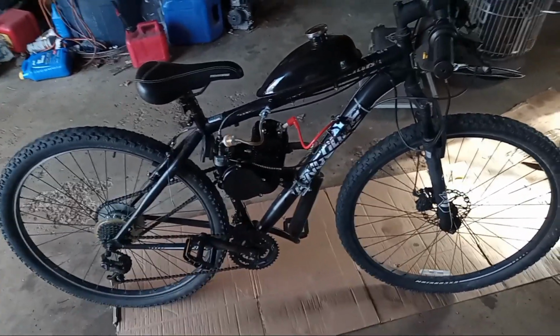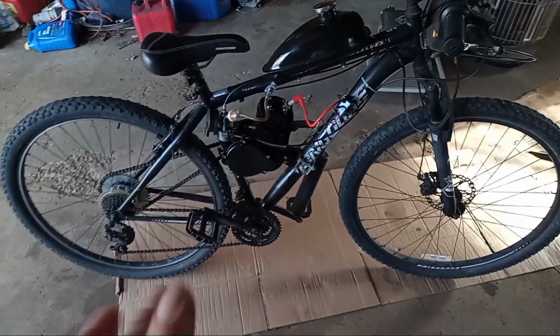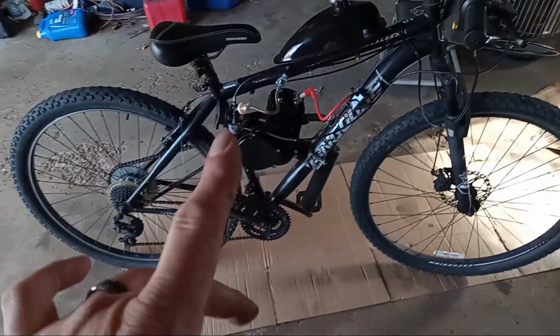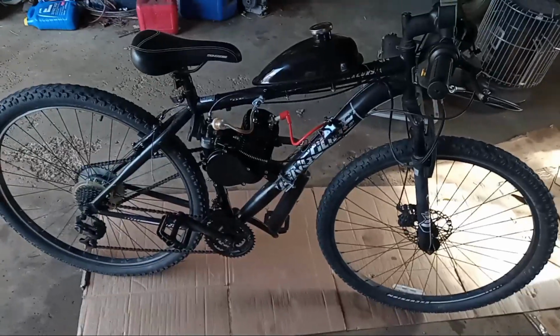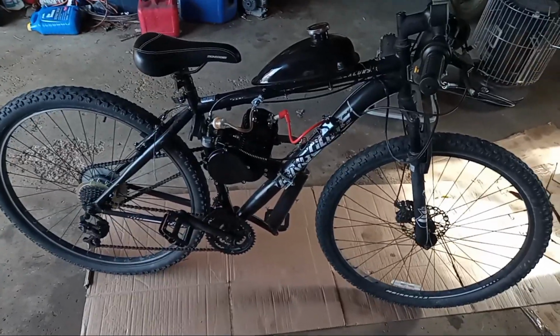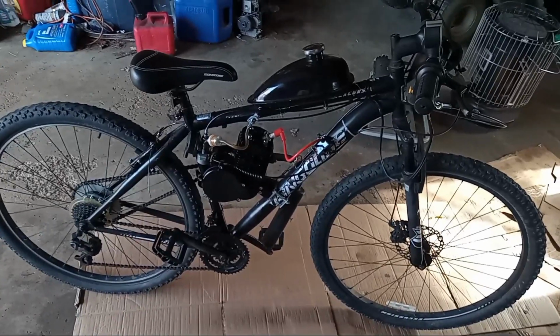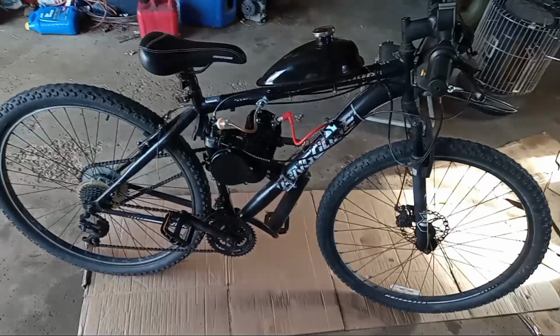Compared to the first video, with a lot of gurgling and chuckling going on, it's a lot smoother. I could probably go up to the very top on that needle clip and it wouldn't hurt a thing. It'd probably smooth it out even more on the lower RPMs. She's still four-stroking in there, but I ain't really worried about it. That'll do. We'll call that good for now.